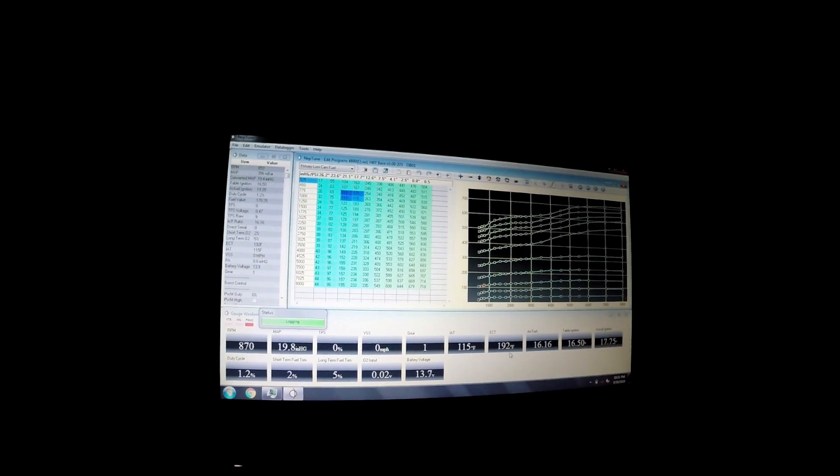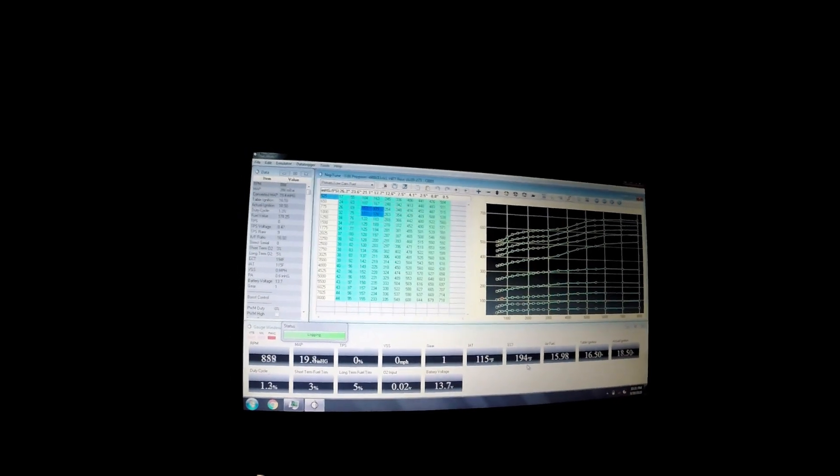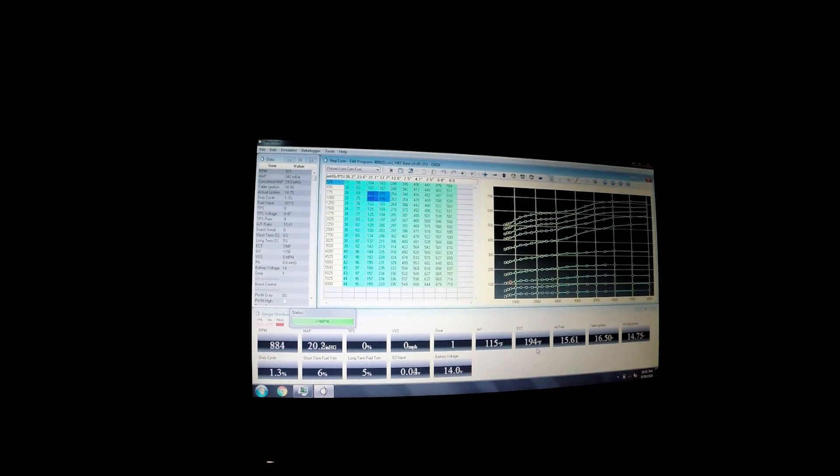Intake air temperatures were able to drop down to like 105-106, so it's like a 15 degree drop. I noticed I was only doing around maybe 10 to 15 percent throttle, which most cruises were around that percentage anyway. Even at higher throttle position it would bring the temperature down even lower, so I'm sure on average it would probably be like a 15 to maybe 20 degree difference at higher throttle opening. So pretty much that's what it is - a two and a half inch short ram intake brought it down to 105-106 from 120 at idle, and at idle it goes back up to 120.